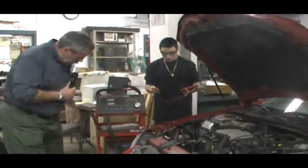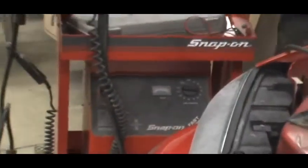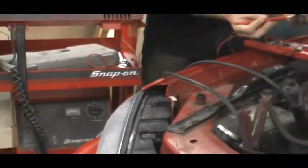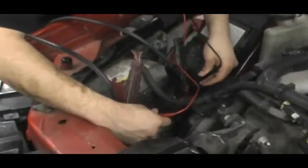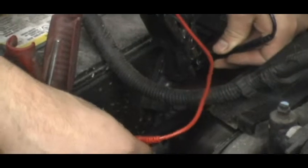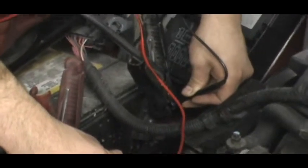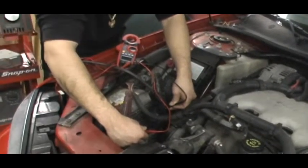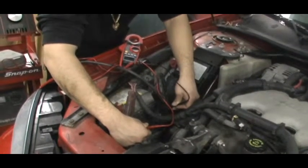While he's doing that, I'm going to turn the battery charger on high. The charger is showing 28 amps — that's as much as we can put into this battery. I've started timing it with my watch and he will be monitoring the volts. With this type of battery, there's just no easy way to do it. We're looking for the volts to not exceed 15.5 volts at the end of three minutes. Right now he's at 14 — he's having a little trouble keeping contact, you will too as you're doing this. Right now he's at 14.4.